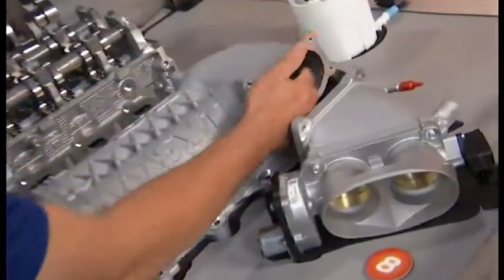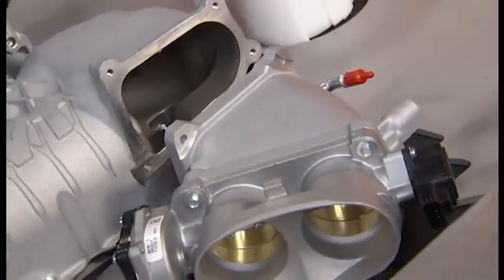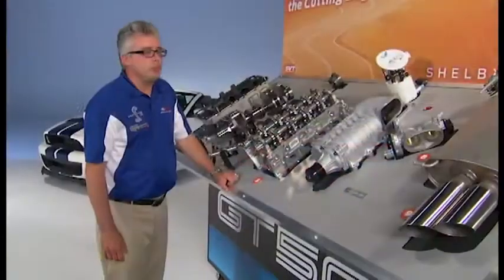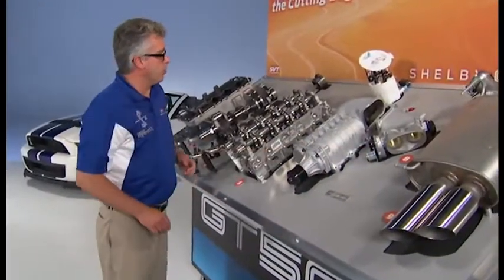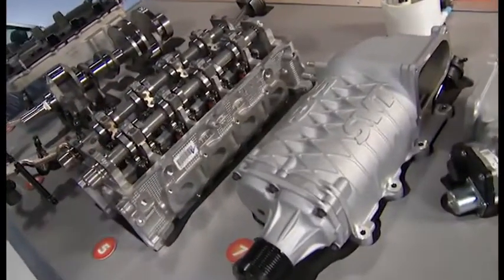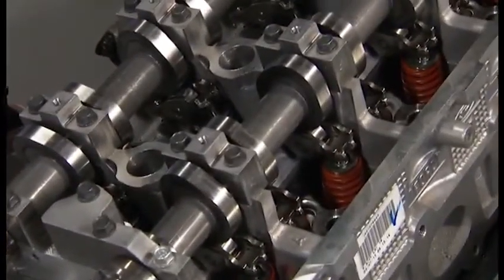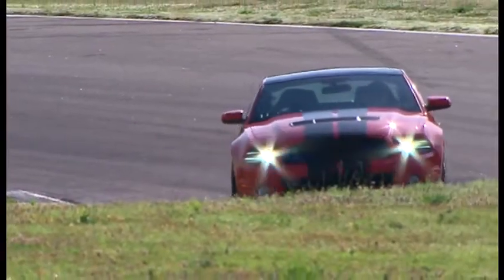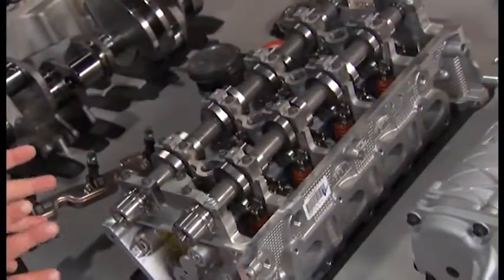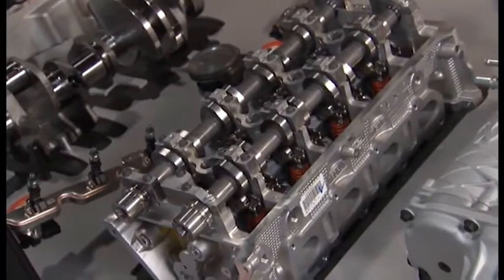We made dramatic improvements in the inlet area here. The throttle body adapter was changed as well as the area up to that, and we found significant horsepower by tweaking those areas. So all of that pressurized air that you just made with the supercharger is going to go through the head assembly. In order to make that airflow happen efficiently we increased the lift on both intake and exhaust cams. All that extra lift on the cams is there to help you flow air and make your horsepower.